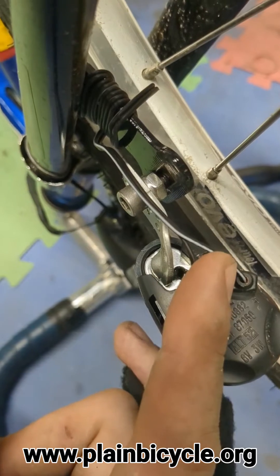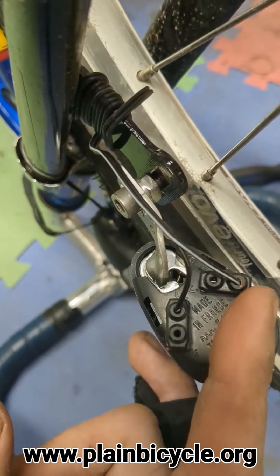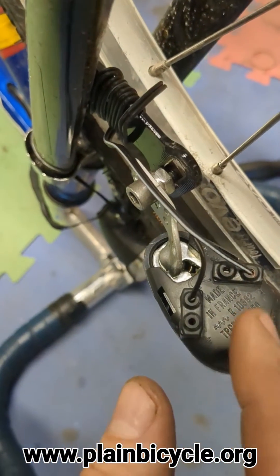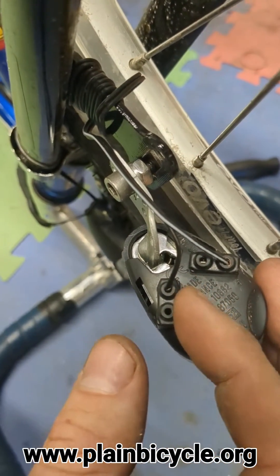What you do is take your wire, strip it, pull out the little plug, stick it in there, and fold it over. I'll show you how to do that on the rear light because I'm not going to pull this one apart.